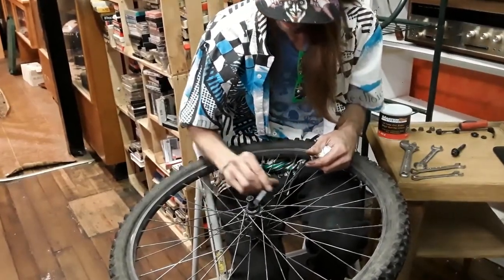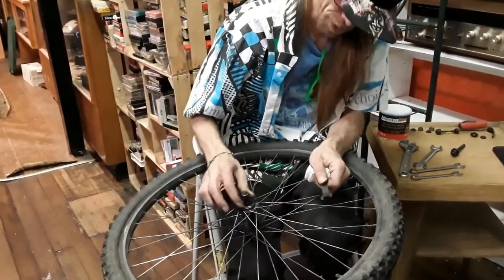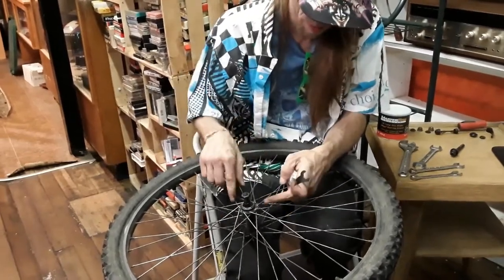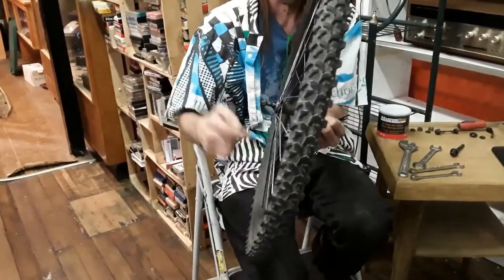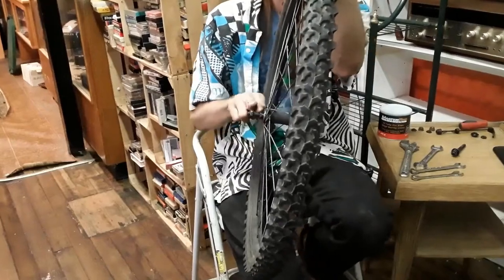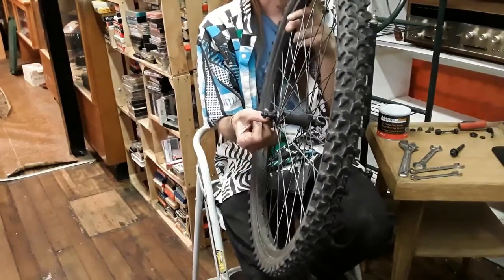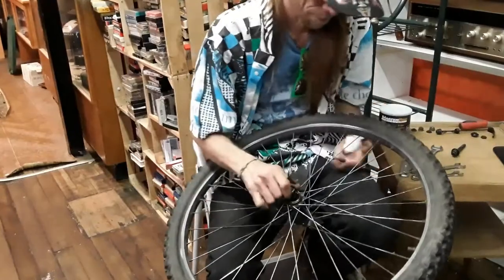Yeah, flat wrench. That way you can get between this, okay, this nut right here. Actually it's only flat on two sides and it's rounded the rest of the way, and halfway down it's fully round. The reason why you get this, because these two will bind together and you gotta break them loose, have the thin. All right. See how it fits? Yeah, it's just got two perfect sides on. And so the rest of it's round.